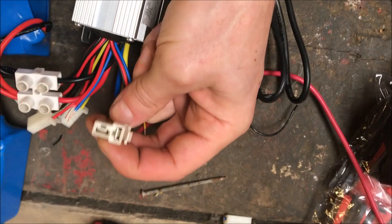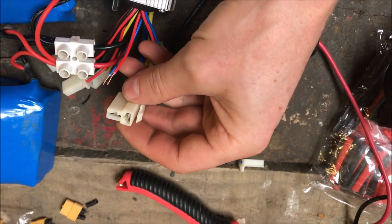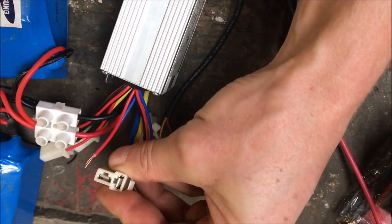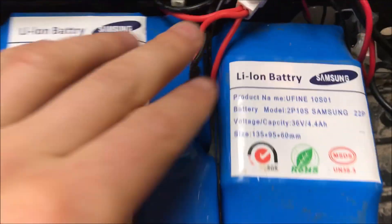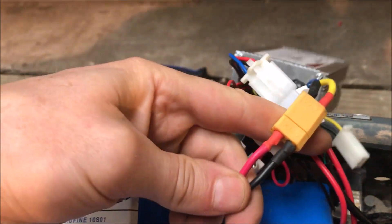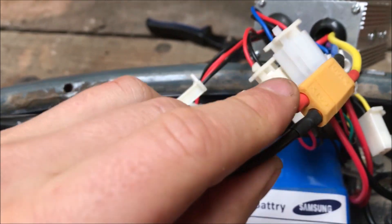We're going to replace all these type connectors with XT60s, because these connectors burn up at 500 watts and they just melt and set your scooter on fire. You can chop them off or use a screwdriver or a really small nail to get the connectors off. It took us about half an hour. All the power wires go into the connector block, and we've replaced the motor wires with XT60 connectors to stop them burning up in future. You can swap them around if the motor is going the wrong way.